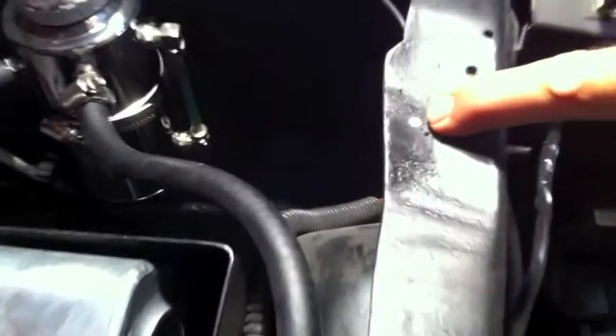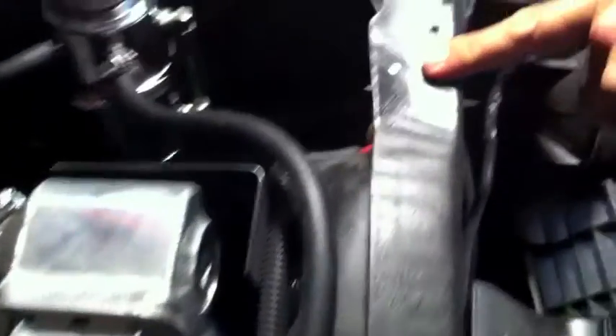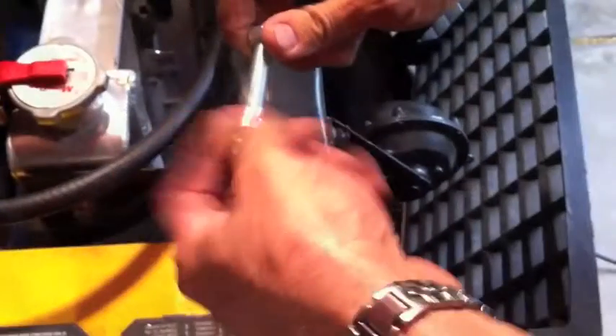There's a mark right here and a mark right here — that's where the pins are going to go. We're gonna have to do a little bit of manipulation of the metal because it's curved up a little bit here, which will set the pin out of alignment. We're going to get these holes drilled and flatten this metal out a little bit so the pins go straight up. There's a board in here to be safe so as I drill down I don't hit the battery or any of the wiring.